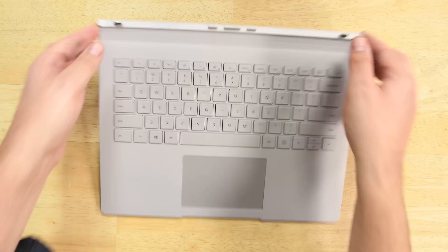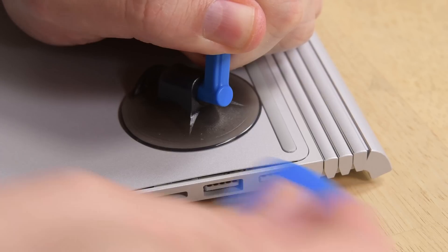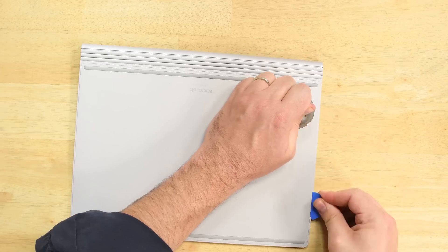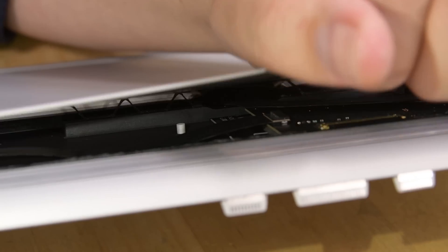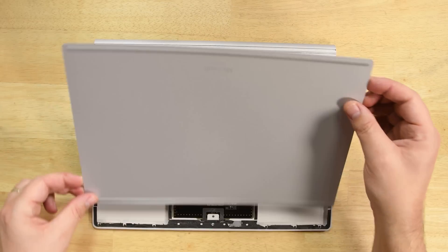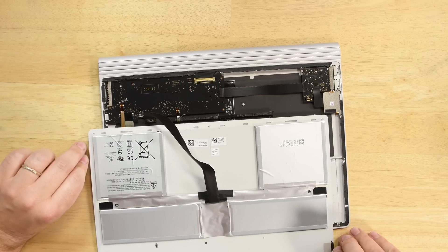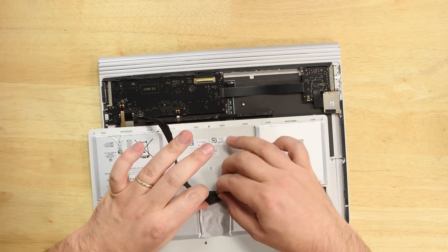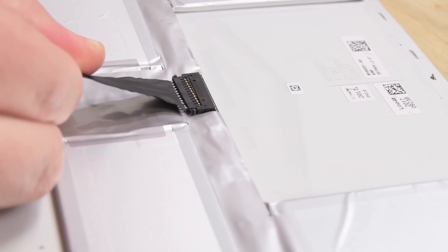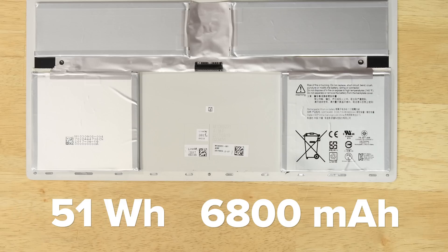So that's it for the tablet. Let's take a look at the keyboard dock. This thing is glued in place not only around the edges, but all around the trackpad and across the middle of the panel. Getting this thing off without deforming it is a serious challenge. Not only that, but the battery is glued directly to the underside of the panel, so when you're heating the back panel to soften the adhesive, you're also heating up the battery, which is not fun. Once we got the back panel and the battery safely off and disconnected, it turns out it has the same specs as the last Surface Book we took apart: 51 watt-hours, or 6,800 milliamp-hours at 7.5 volts.